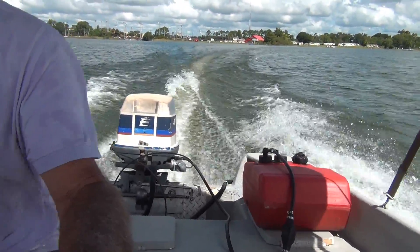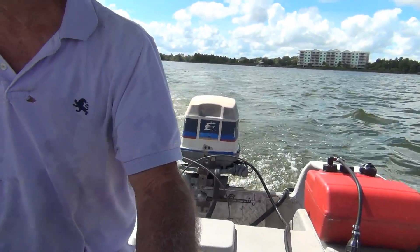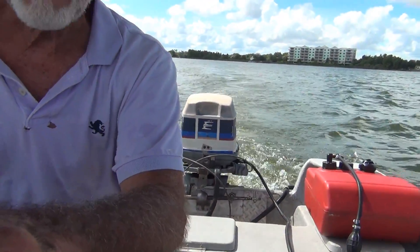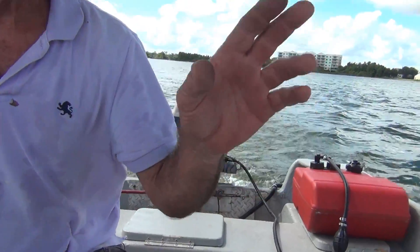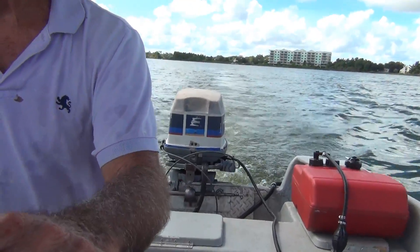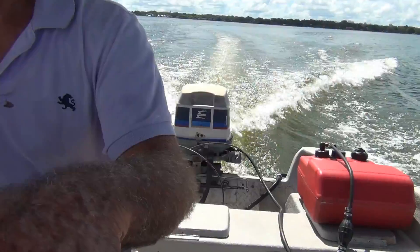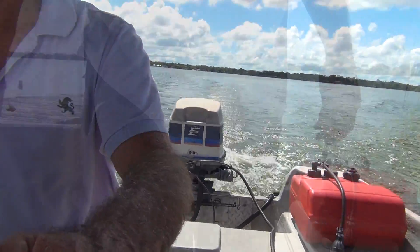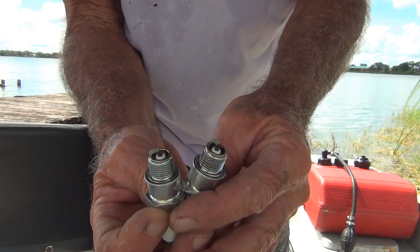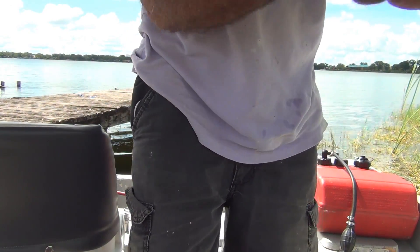I'm only hitting 22. They're gapped at 34, half-gapped plugs. I'm going to take them out and re-gap them. Let's go with 30. See what happens. I mean, I'm solid 22, so I lost a couple miles per hour. I'm thinking too big a gap. Cut them down to 30. I can hear it right there - sounds weak. They're hot, but once again they look nice. Nice and clean, pretty. I don't know which one came out of which, but I'm going to change the gap from 34 to 30 and give them a shot.